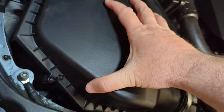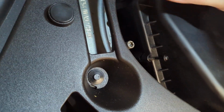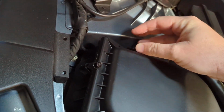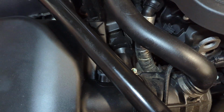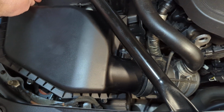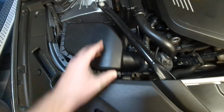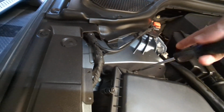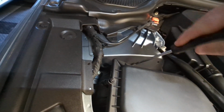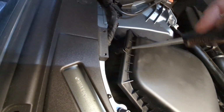Then I grabbed the box and made sure that my screws are lined up with those holes, and that the whole assembly is set up so that the screws go into their holes and they're not wonky and sticking out the side. And you just do this one by one for each screw. And then you make sure that this upper box is mated really well with the lower box. We'll just screw these in one at a time. It's plastic, so as I screw things in, I'm making sure I don't feel any crazy tension, nothing stripping. As soon as I feel anything hard, I just back off.